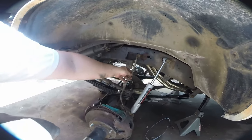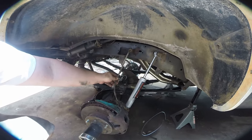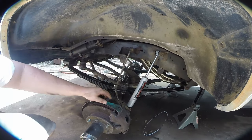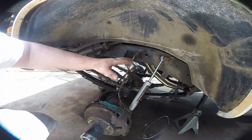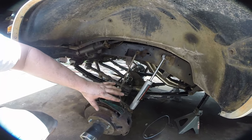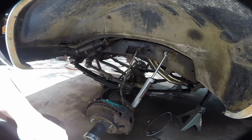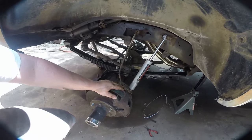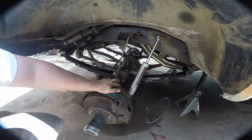You can see this is why we get an extended brake line. The suspension is at full droop and you can see how tight this is — if one side went into a gully and was forced down by the other side, this would let go. So the next thing we're going to do is the part I've been dreading the most: replacing these brake lines.